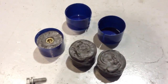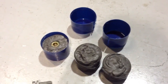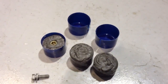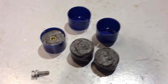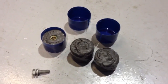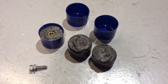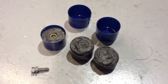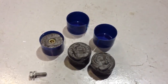Since then, from speaking to people on the forums about what they want to see, we're going to be replicating an OEM box section for the rear subframe. We've already started taking one of our old subframe panels from a car, sectioned it up, opened it out, and seen how the inside is held - checking the threaded receiver, the thickness of the panels, and the outer skin to replicate the volumetric size. We're also going to try a deployment into a wax cavity that's been freshly waxed.